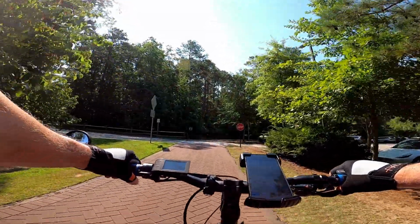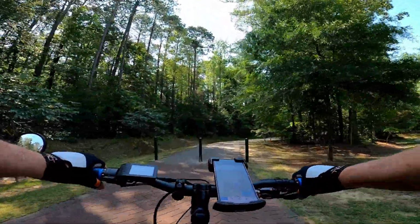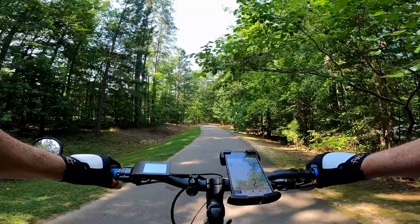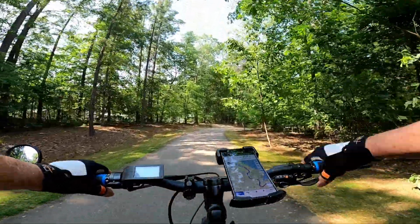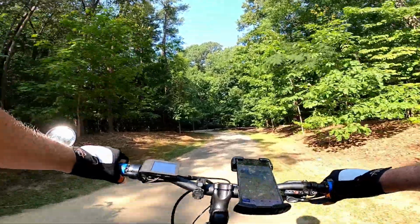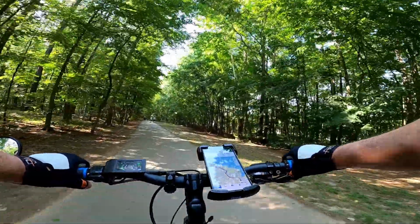So there you go. So what are my final thoughts on this? Well, let's take a look at the advantages and disadvantages. With the Suntour, I consider the main advantage to be the way that seat goes on. Very, very easy to change or adjust your seat. That's got to be a big plus right there. Of course, you've got the name Suntour. It does bring some reliability with it. You've got a dust cover that goes over top of it, and it does seem to work pretty well. You've got preload adjustment on it and everything.